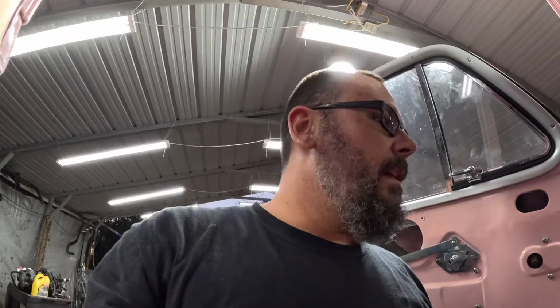At worst case scenario, it's just steel. I could either copy it, make another one. It would take a little while, but I could do it. Or bend it back, weld it up, take it to work, deck it flat again, and nobody'd ever know. And it would be just as strong. But I'm gonna notch it, and we're gonna bend it, and we'll see how it goes.